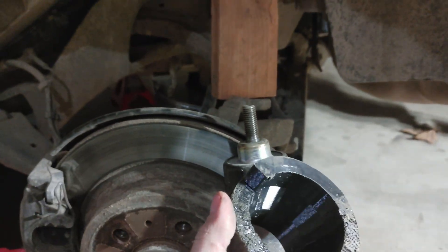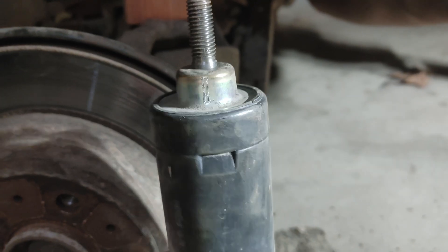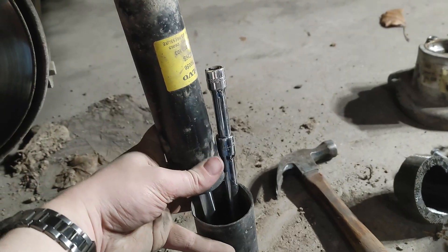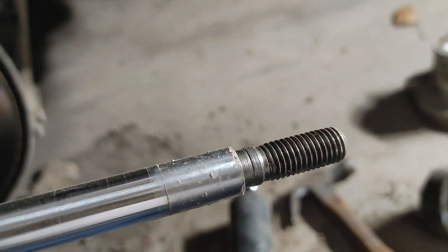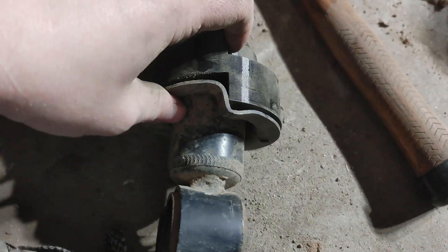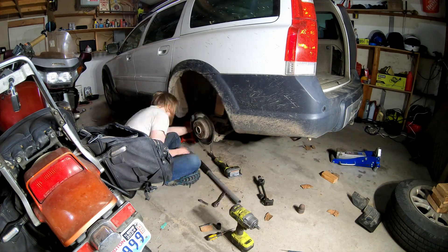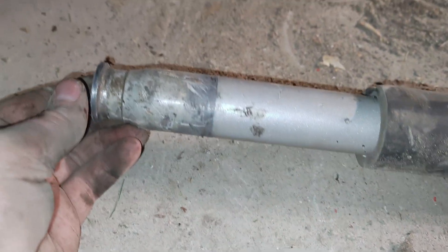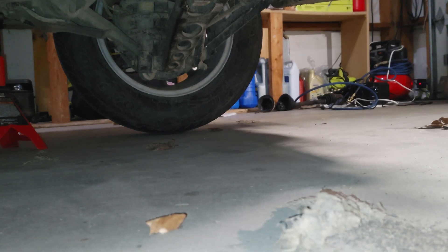What I've got going on here is I have my 3D printed part — it's supposed to sit right down at the bottom of the shock. However, this dust cover is preventing it from going over and it doesn't seem like it's designed to be removed in any way, so I need to figure out some way to get around this. My ingenious solution: I got a bunch of extensions, hammered on them, and it came right off. I don't know if we'll be able to press that back on, but hopefully now we can install our 3D printed part. And that sits on there just like that and lifts our coil up. I just had to do a little prying with my pry bar and a little hammering and it popped right on. Now that I have a strategy, this side should be twice as easy.